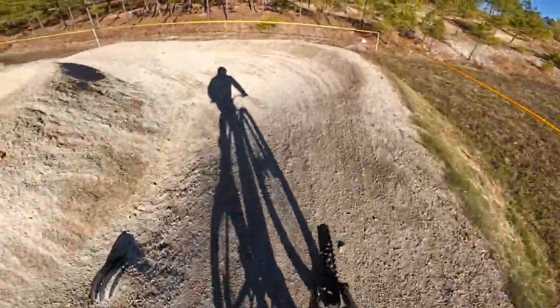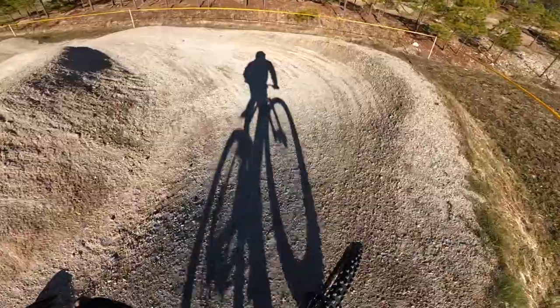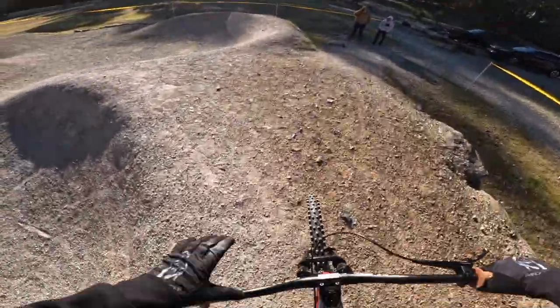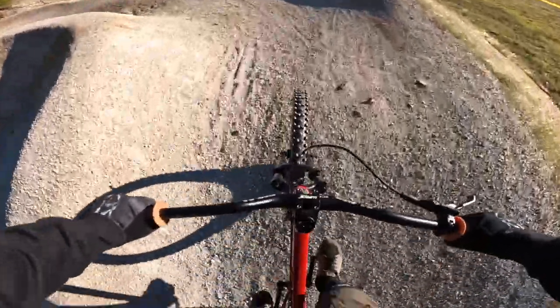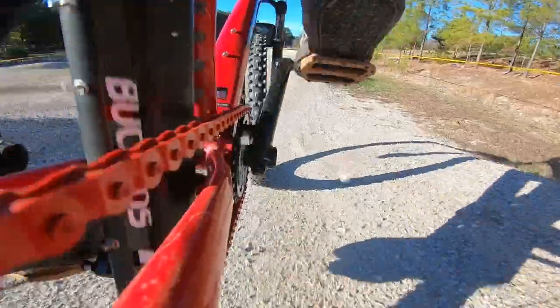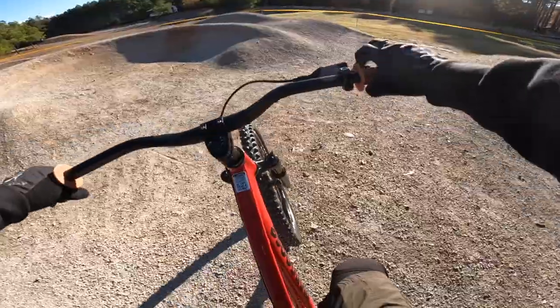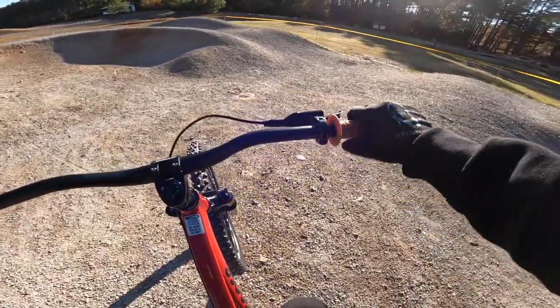There's a lot of travel on this fork for sure. The 120mm is probably going to be a little too much and we talked about going to 100 sooner or later. The front is up a bunch — we've got a lot of rise on the bar — but that's stuff we can fix. The pedaling motion is great, it's just cold out here so it feels like I'm gassed already. The grips feel nice. The width of the bars does feel a little long — it's a 780 — so I'm curious if we might have to cut those down.